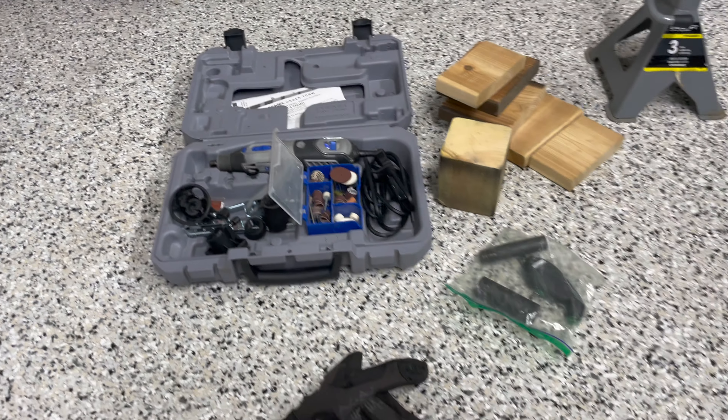Now, I had bought a fender roller from Eastwood and I did it kind of on impulse thinking I'm just going to roll the fender — there's not that much of a lip here, right? And I read about it and I was like, I'm just going to pull it too. So pull it out a little bit to gain some more clearance because I did go a little wider on these tires — I went to 275.